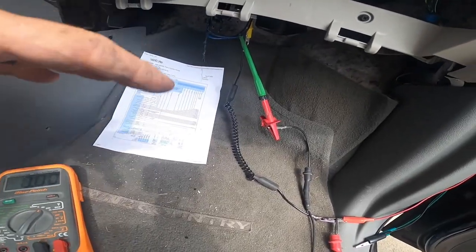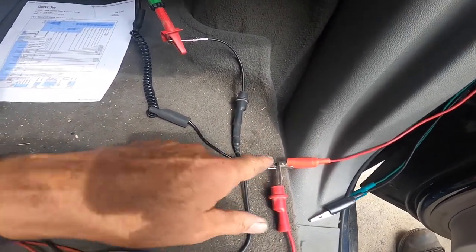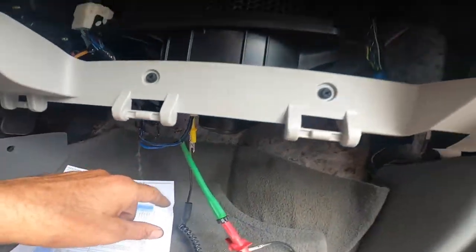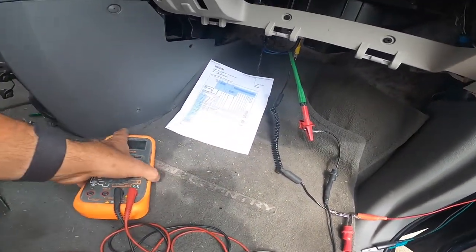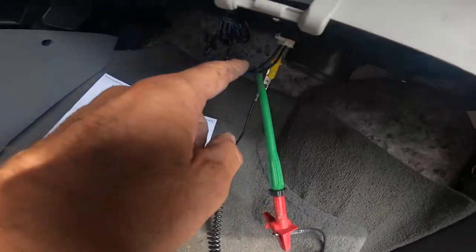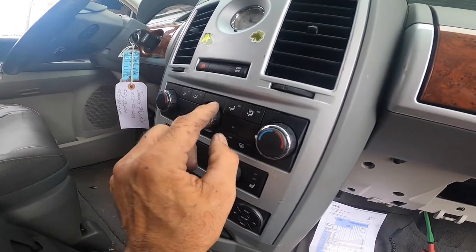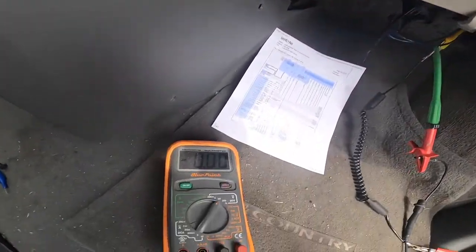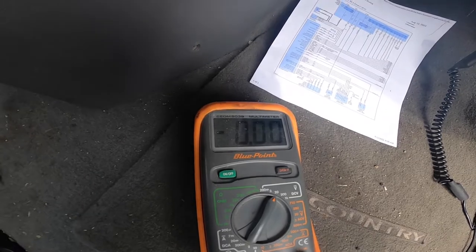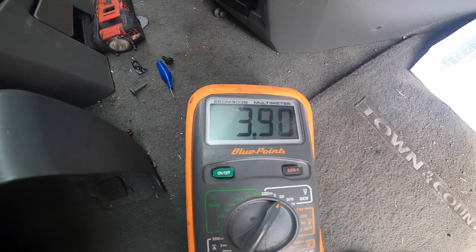Let me explain my cluster of wires here. I've taken one test lead hooked to the positive side and ran it to the positive side of the blower motor. I've taken my multimeter hooked to the positive side of the battery and tapped into the ground wire. The simplest way to explain this: as I turn that switch and increase the speed, the ground signal should increase going to the blower motor. We're off right now — that's low — so the ground signal going to the blower motor is 3.9 volts.